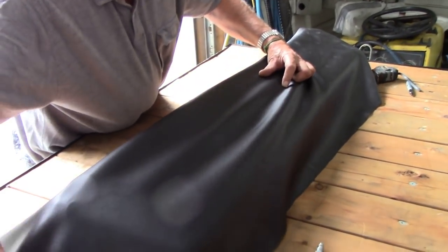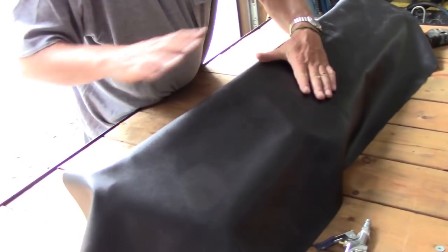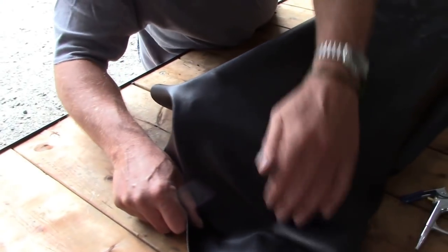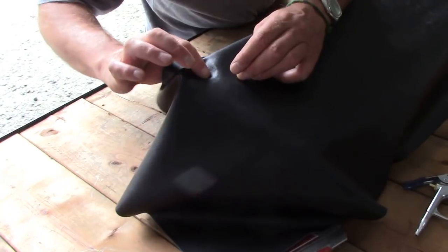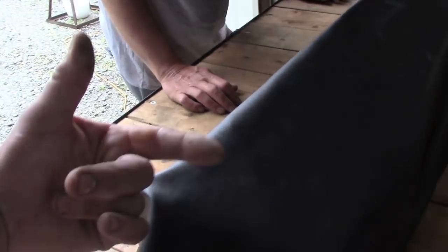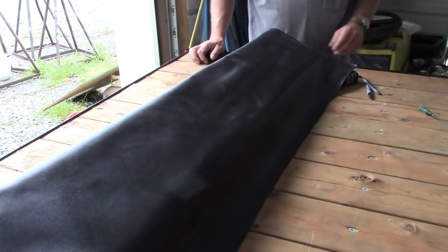It's gone, yeah. And as you stretch, you see that little hump in the middle there? We need to pull that either side. But now we know we don't have to pull quite as much. But look, this is the nasty bit. We'll sort that out. I think if we leave those bits till last, like we did last time, squirt glue inside, I think it's going to be all right. So that's how we lay up our vinyl.